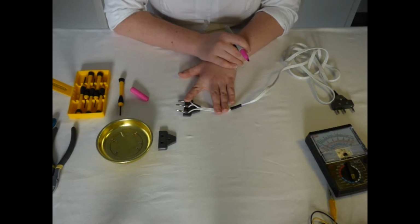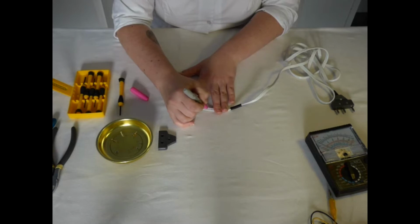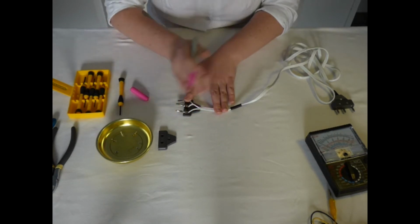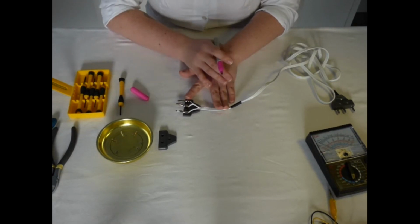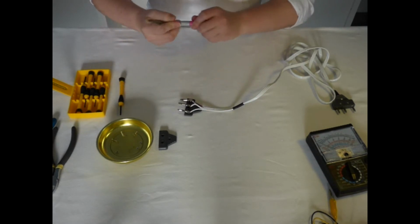Draw a dotted line down a second wire, the same distance as your first one, and leave the third one blank. This is just going to give me a quick way to differentiate the wires without needing to retest them. Go ahead and make a note on your diagram about which one is marked, and this will make life a lot easier when you're putting them back together.